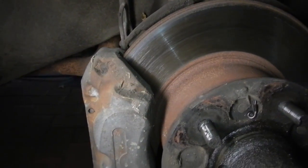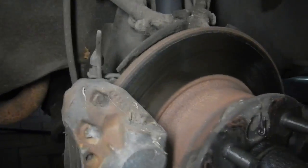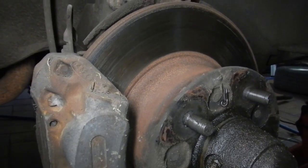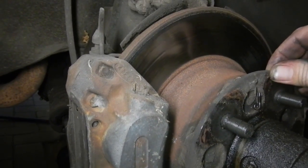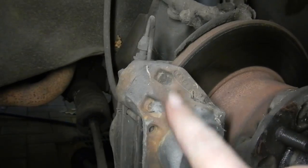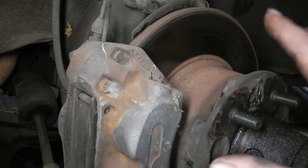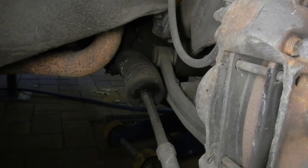But it's had new brakes fitted not too long ago. Calipers are good, pads are good, discs are good, hoses are good, but they're all standard 6-cylinder Series 1. So might be best to upgrade to Series 2 vented discs with 4-spot calipers. But yeah, we'll see how it goes. The Series 1 brakes aren't too bad, just gotta let them cool off.